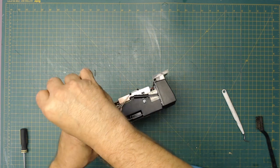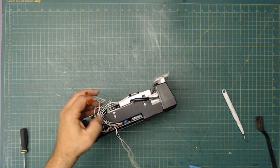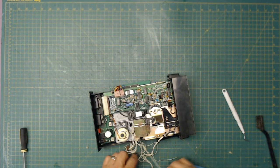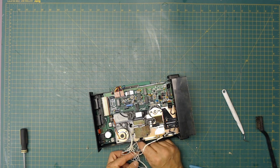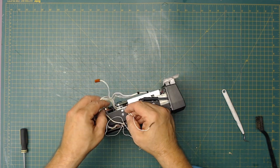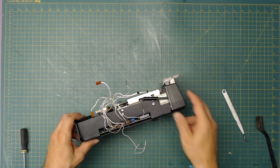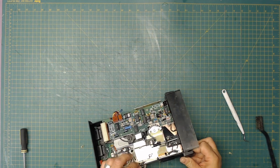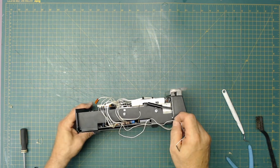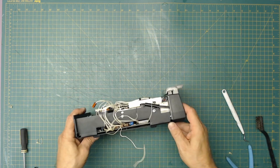See, these are the two wires for the sensor, and they appear to be pin 1 and pin 2. That's those two, and the sensor is on that one there. Now let's find the loose wire we have here, and that's this one over here. I'm pretty sure all four of these wires on number 3, yep, okay, so number 3 is the track 0 sensor. The first two wires of number 2 are the index hole sensor, so we still do have to have those in there. So technically I can now chase down which is ground and which isn't using continuity. So let's just try that.